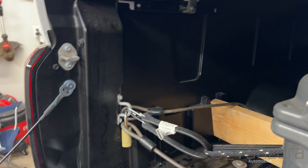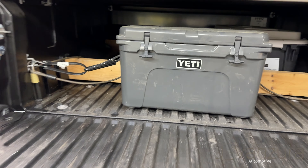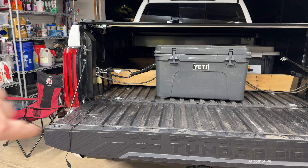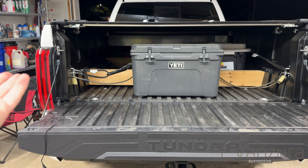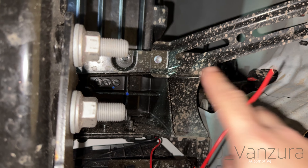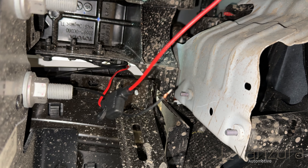I've got a little bit of inspiration to do some of this wiring. I'm not entirely sure I'm going to finish all of it, but we're going to try. The idea is putting my switch right here — it's going to always be on if the tailgate is down, but I want the switch there so I can still open it up and turn off the lights if, say, I'm working on something on the tailgate in the middle of the day and I don't need the lights on. I'm actually going to be grounding to this bolt right here, and my power is going to come from the blue wire that we just checked. Everything else is going to be up top — the switch goes in, then the lights, and then we're pretty much done.